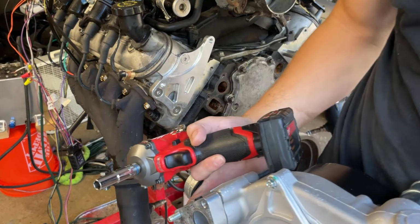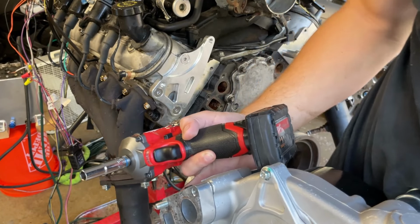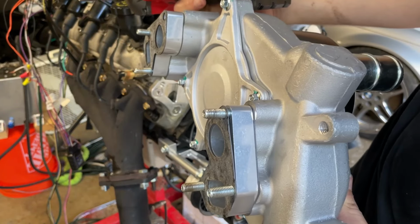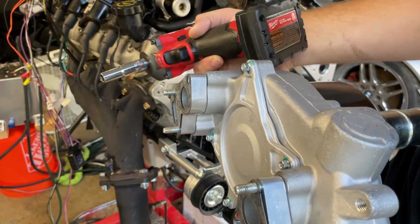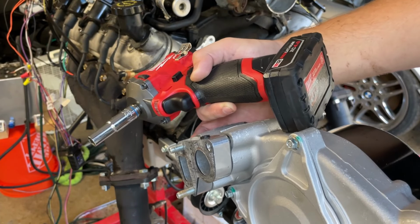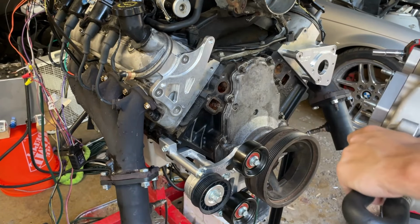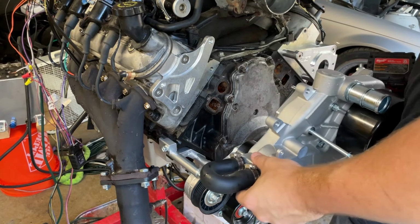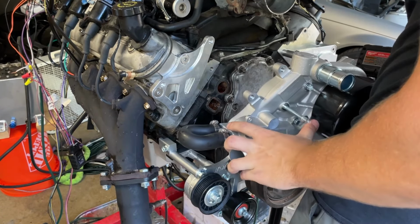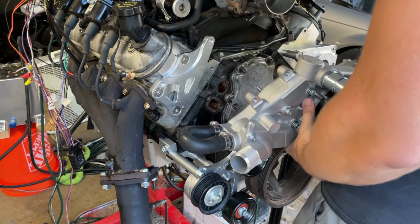So this water pump with these spacers, I don't know if I talked about it before or not, but it makes sense spacing the Camaro water pump off like the truck one is. And there's a set screw on that side. I believe it's supposed to be on that side because it doesn't clear the alternator when it's installed. But make sure you have that set screw on before you go to do this. Otherwise, it certainly sucks to put in.